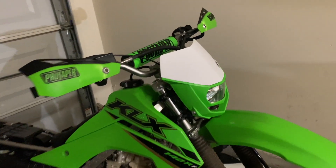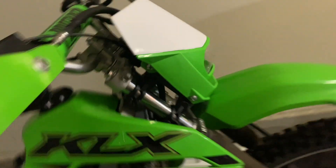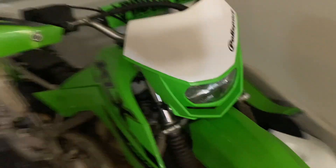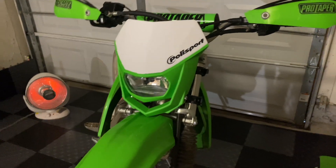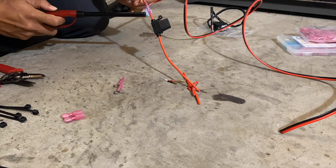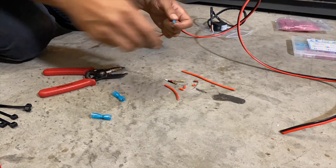The headlight is temporarily mounted on the bike. I went with the narrower brackets, which I think is the proper fit for this application. I also moved the choke over to the side, which leaves a lot of clearance on the back side of the headlight for the wiring. I also bent the brake hose inward so we can tuck the front brake line inside the headlamp. I think the front end looks a lot cleaner this way.